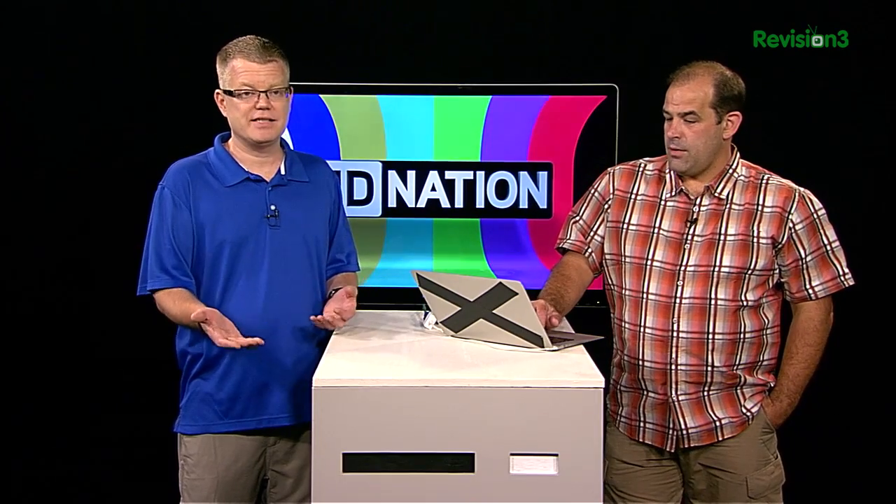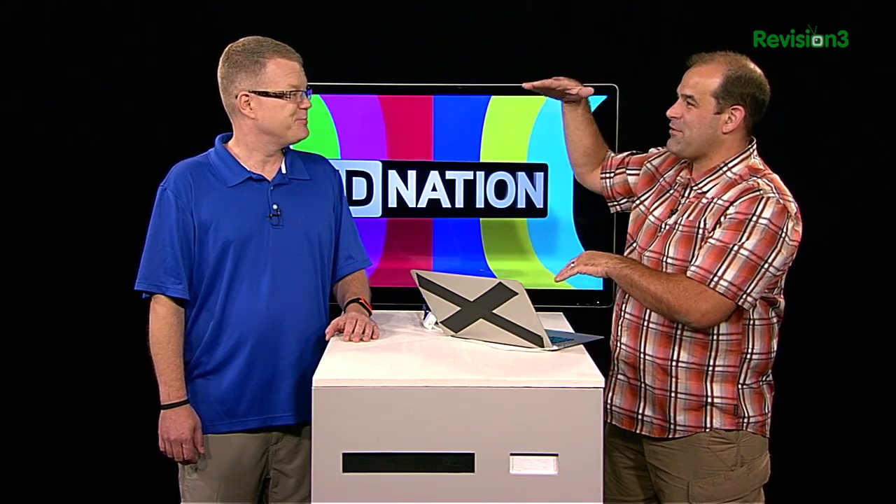If there's a microphone inside your AVR, find out what it can do — if it can auto-calibrate, it might adjust the high end, low end, and timing. For any AV receiver or home theater in a box, there are adjustments for level and timing available at every price point, so you can take a tape measure and sound pressure level meter and do it manually. You don't want one speaker with a higher level than the others — unmatched timing and levels significantly degrade surround sound quality.